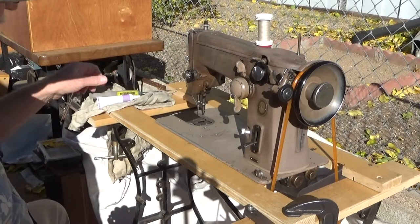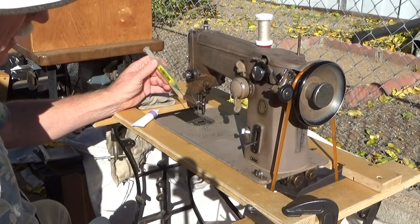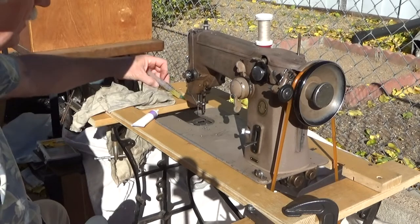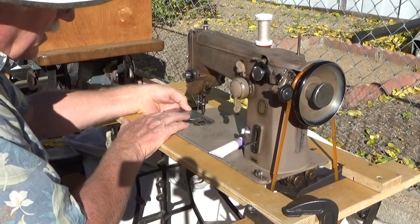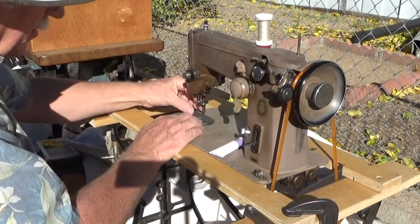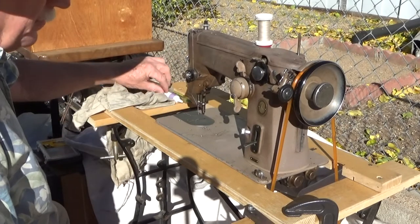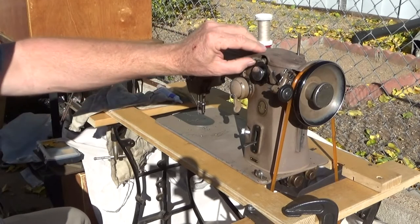Should that occur, what you need to do is loosen these two screws slightly and nudge the dogs back and forth until they align properly with the plate. The other major source of noise from this area is this follower — it tends to drop down.